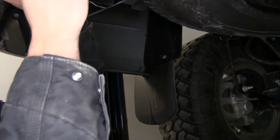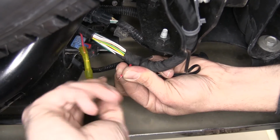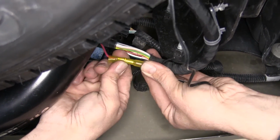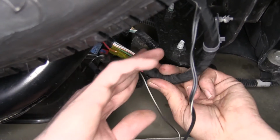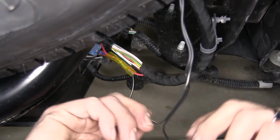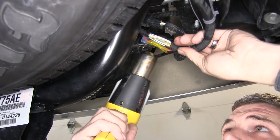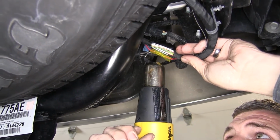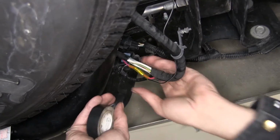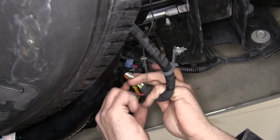With our power wire spliced back, we'll kind of spin our red and black together there, our power wire and our other one, and put it in the crimp and crimp it down as well. All right, now that connection made, it's good and tight, we're just gonna wrap this up with some electrical tape and clean up our look. I would just use a heat gun and shrink these down as well.